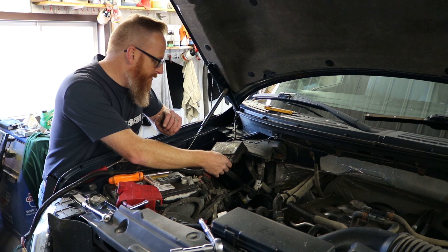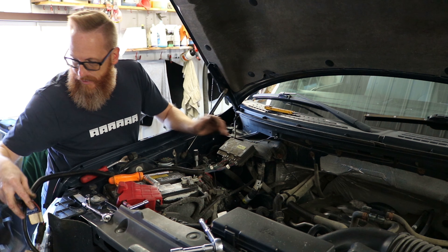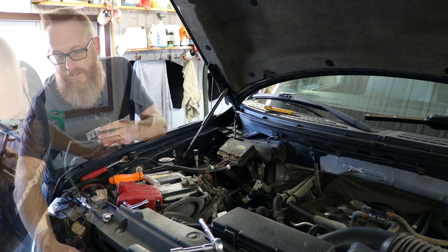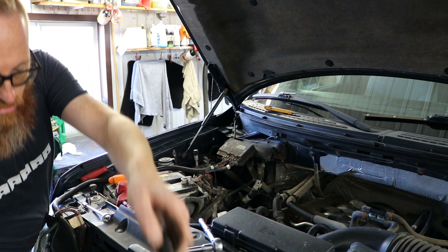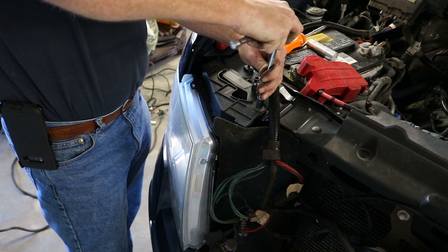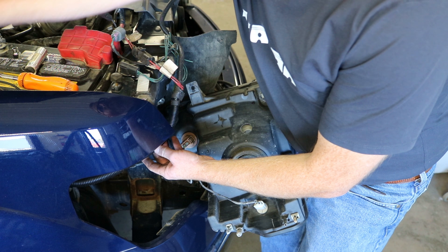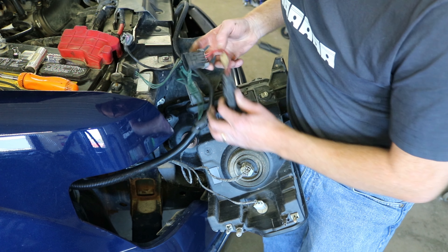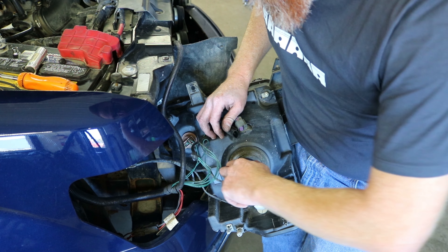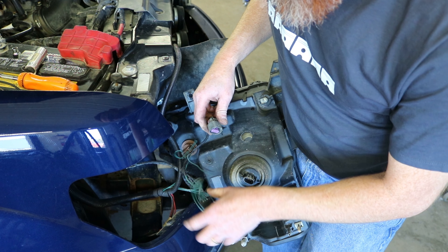The next thing we've got to do is mount the control module, and I think we're going to mount it over here somewhere. We're looking at running the headlights, so I've got to get the headlights out so I can plug everything in here. We've got the headlight out and we've got this wiring harness kind of weaved up inside the inner fender with the control module up behind the battery box. The way these wiring harnesses generally work is that this is your whole lighting system — you unplug your headlight, it plugs into the wiring harness, which powers the harness back through the module and out through this plug-in which now plugs into your headlight.